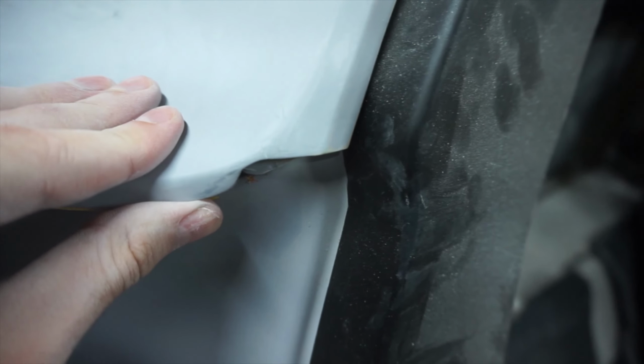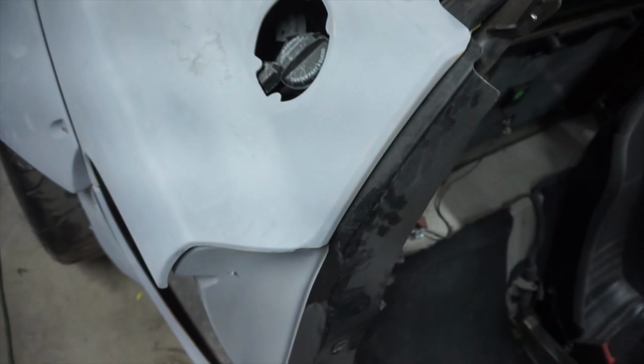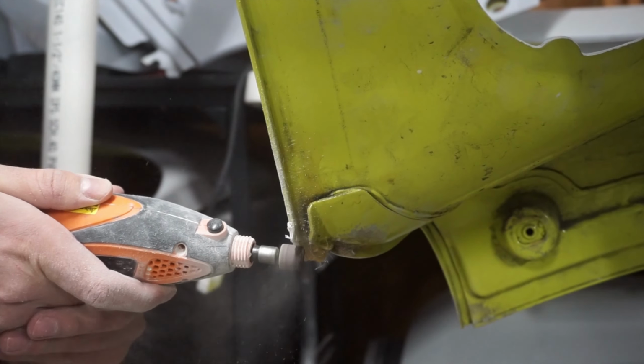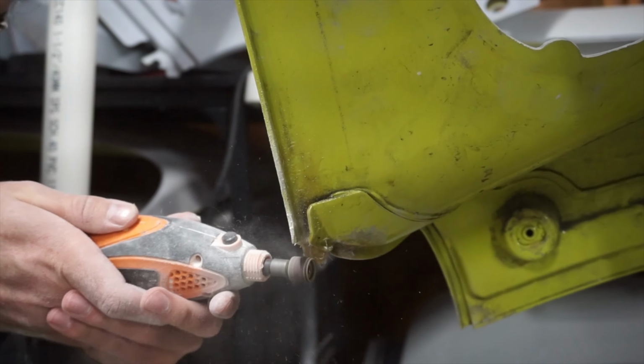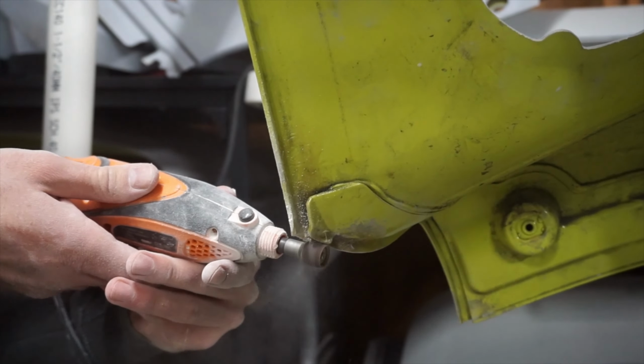So, on the topic of fixing previous mistakes, this crack that I filled in before had cracked again. So, I put fiberglass behind it this time, because even though I couldn't identify the crack before, like where it cracked and the backing, regardless, I reinforced the back, and then we'll be filling it again like the other panels.